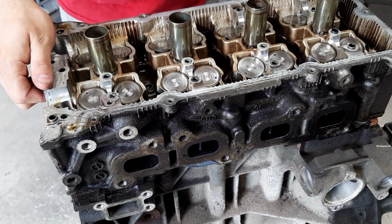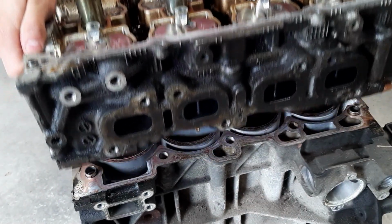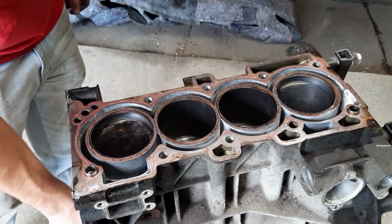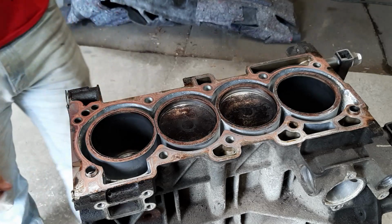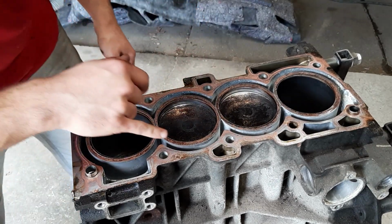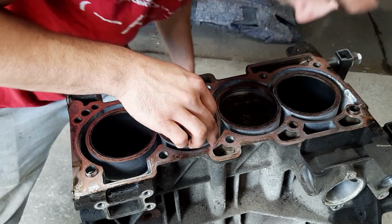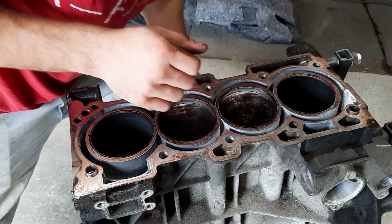All right, see what's underneath here. Don't think I forgot anything holding the head on. Nope. Wow, that takes absolutely zero effort to spin. Smooth though, obviously there's no damage to the bottom end. I'm not specifically seeing any surfaces that leak. This coolant one might have, no. That one's not weeping. Honestly, they all look fine, really.